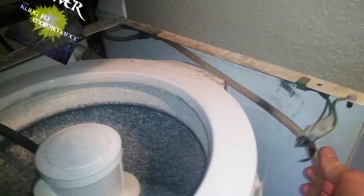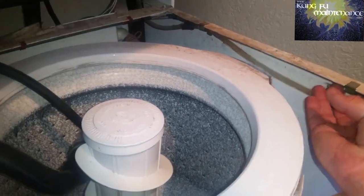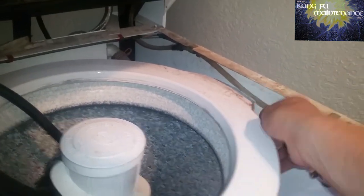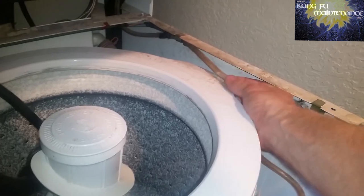Machine unplugged. Basically, what happened is this air hose unclipped from its mooring, from its clip under there. And this deal was sitting here, bang, bang, bang, bang, wore a hole and split the deal. You can see a pretty good split. See it? It's open.